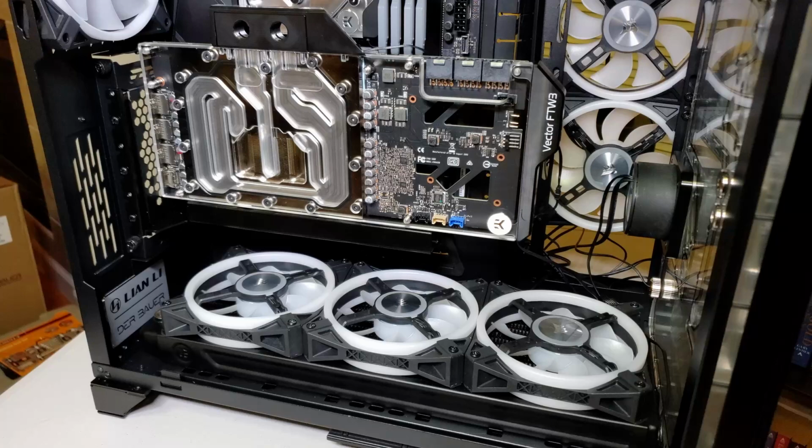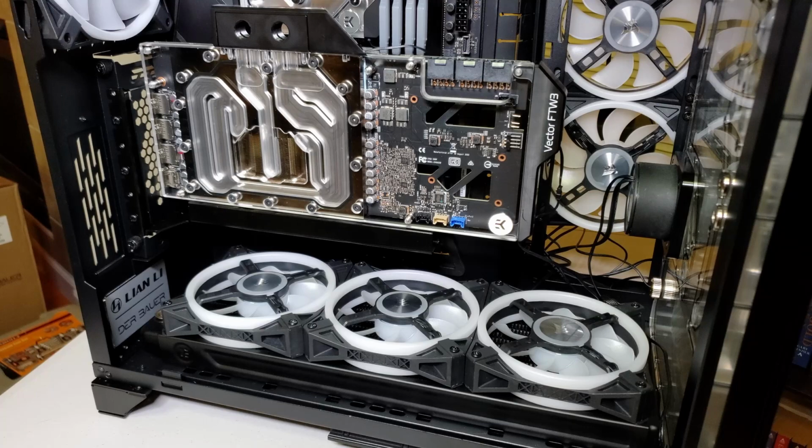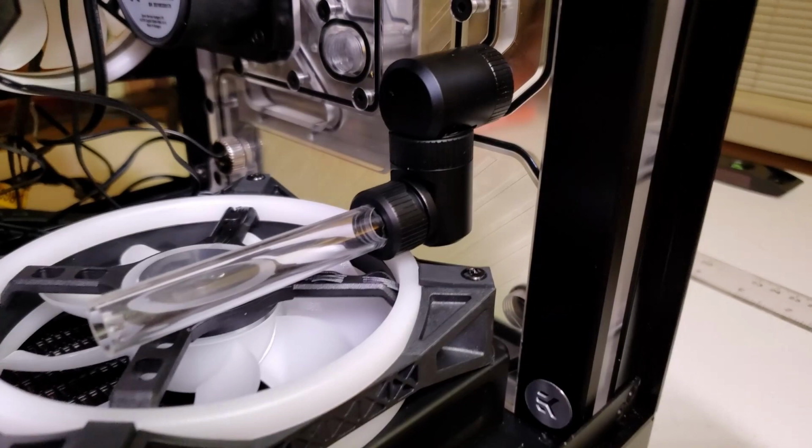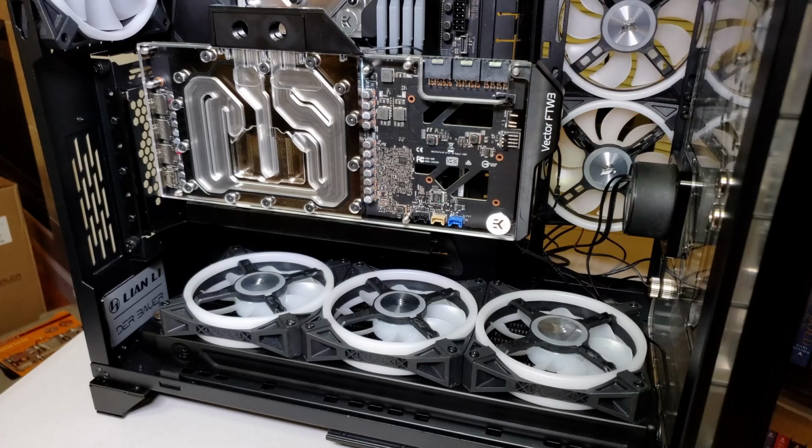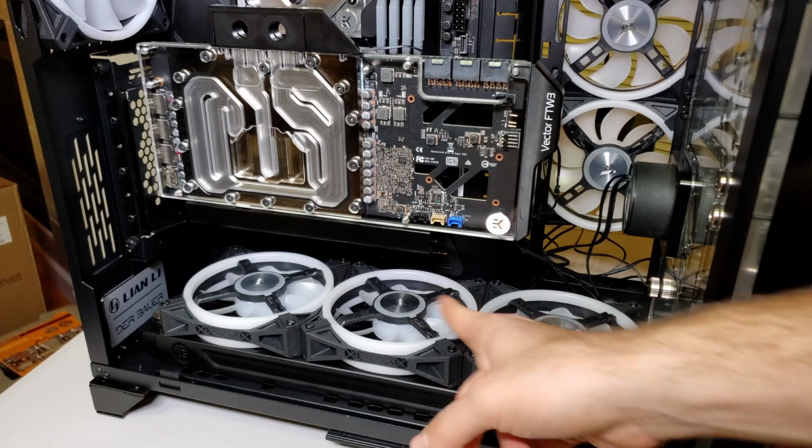Because if I had wanted to mount this thing such that there wasn't even the tiniest bit of obstruction on my CPU water block or on the bottom 5 millimeters of my light up memory or something like that, I would have had to put this in the lower orientation and I would have had no shot at getting that lower run to be nice and straight and not have to do something strange with additional fittings or go around a corner or do some other different height from the other thing. And that was more important to me than not overlapping the tiniest bit with the bottom of the memory here, as you can see. My personal opinion is that, yes, it's a little bit of overlapping, but I'd rather get the bottom nice and basically the same on both sides.